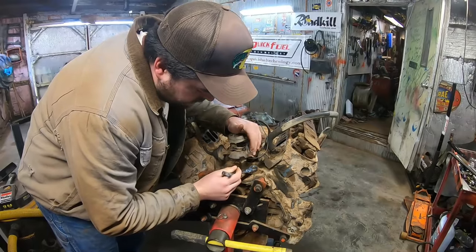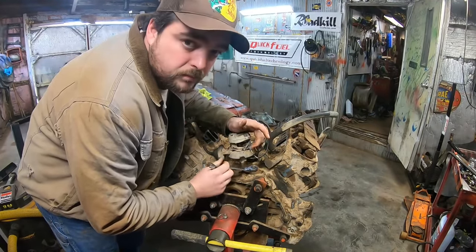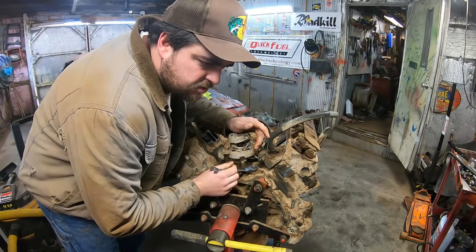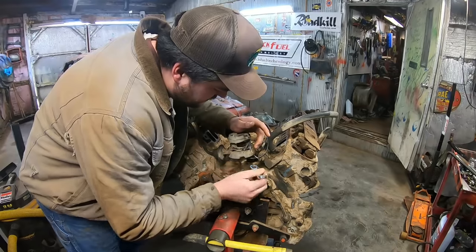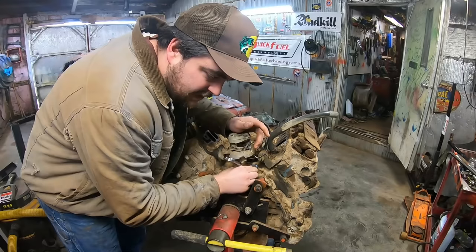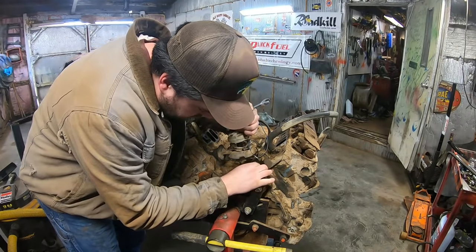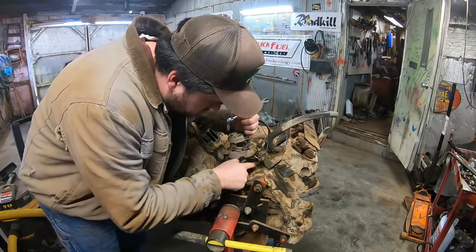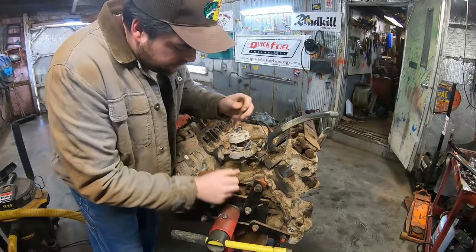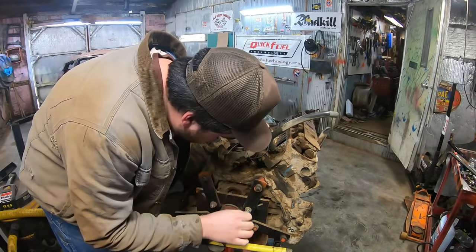Whenever you're taking apart any old engine, not necessarily one that's in this bad shape, the other thing to remember, the Pontiac in particular switched to an alloy pot metal aluminum something distributor housing, what, like '63 or '64? And the issue with that is alloys and iron do not get along. Whenever they sit and get moisture on them, they basically weld themselves together chemically. And I would be shocked if this doesn't fight us quite a bit.